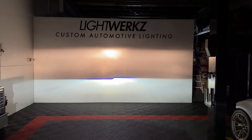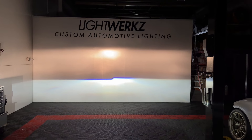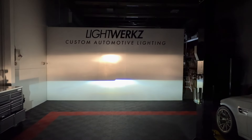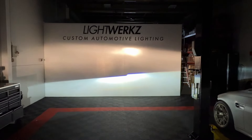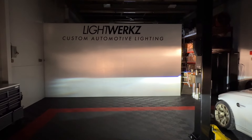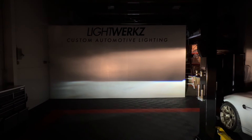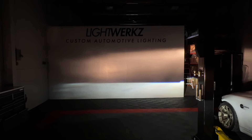The intensity zone on the halogen is a little sloppier — this reflector is pretty good but it's a lot lower, and because it is optimized as a low beam only, you can see it's a little low. You're kind of left with a round ball hotspot, though it's going to be decently bright. We'll do a lux comparison to measure the intensity. Looking at the width, the projector retrofit not only has an overall wider beam pattern but it's brighter throughout that width, and that will be what's giving you the intensity to the sides.